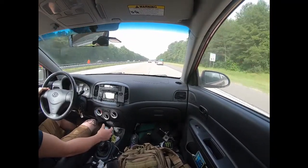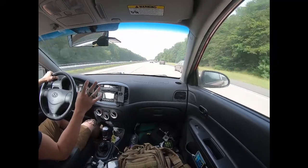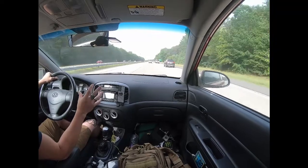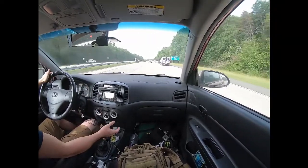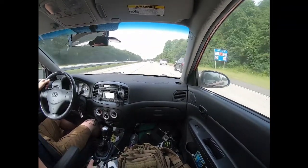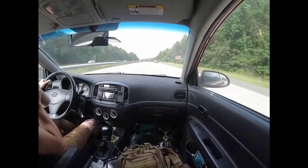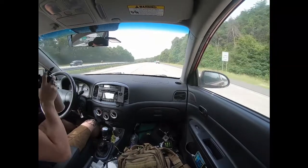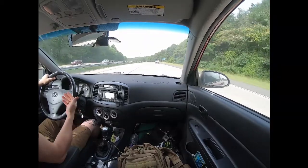She actually was holding pretty steady at idle, I'd say 500 to 1,000 RPMs, which is good. There's a little bit of misfiring happening here and there. I have to probably get new spark plugs and do a very thorough cleaning of probably the intake and everything.